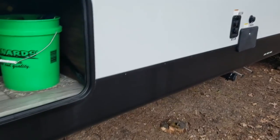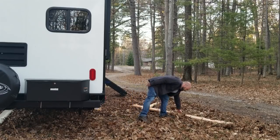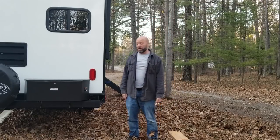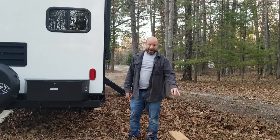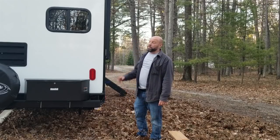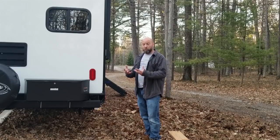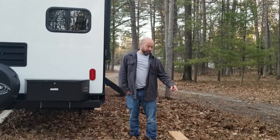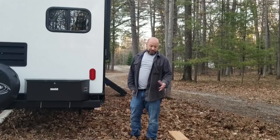If you're not on pavement, park your RV on top of 2x6s or 2x8s — the 2x8s are better. Get the tires up off the ground to keep them away from moisture and protect them from rot. This isn't my first trailer; I've owned dozens and it's just the right thing to do. These pieces of 2x8 here are leftovers from cutting them to the right length to get both wheels sitting on them.